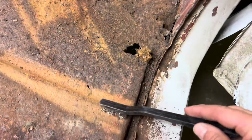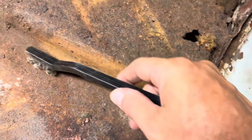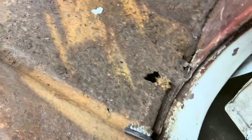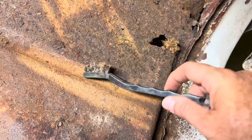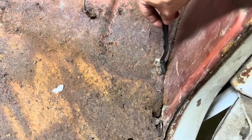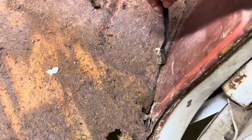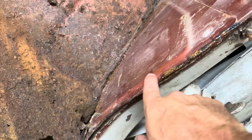The more I clean it up the thinner it gets, so I'm gonna keep cleaning - maybe use a better wire brush or grinder - and clean back to where I know it's solid, then cut it out and put it in. I think what it's looking like is I'm gonna cut right here at this floor indention, then come up here and over, and try to cut and do it all in one piece. I have some spot welds to cut out right here.